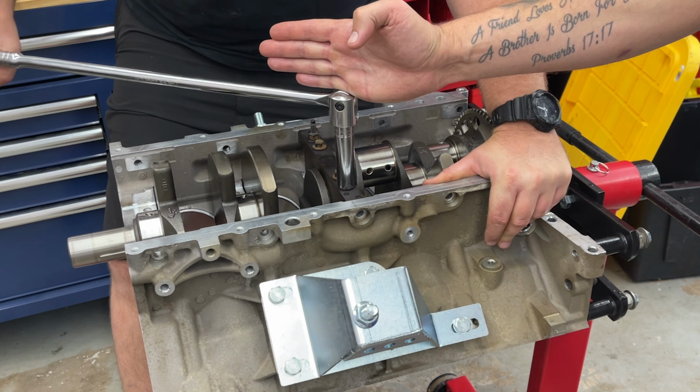That's pretty tight. Me and LS Matt have determined that the mains are too tight. The bearings I got didn't have an extra thousandths of clearance, so I ordered some. So we're gonna go ahead and move on to assembling the rods and pistons and checking the rod bearing clearances there, which are an extra thousandths because I was able to get them. The other ones I waited 6 months, 7 months, and it just didn't come in. So I got some other ones. So anyways, we got the right ones on order. We should have those back in a couple days and we'll check them whenever we get those. But until then, we're gonna keep rolling and see what we can get done today.